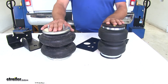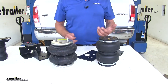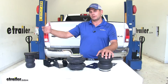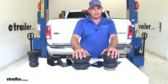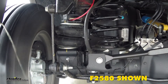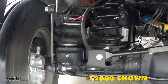When you do install airbags in your truck, you are going to improve the ride quality — a lot of customer reviews mention that. When you increase the ride quality in your truck, you're also increasing the ride quality in whatever you're hauling, whether it's an enclosed trailer or a camper trailer. Having airbags in place of a jounce bumper replacement, which can make the ride a little bit harsher, can really save some of the equipment you might have in your trailer or the back of your truck.